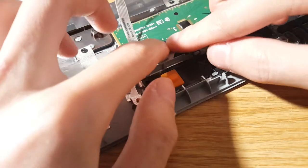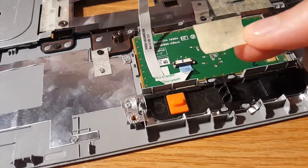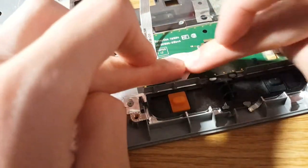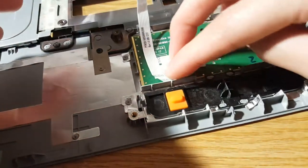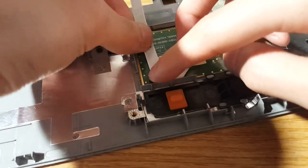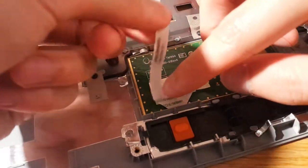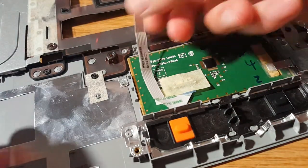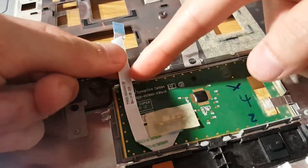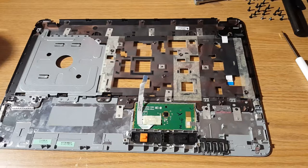You may or may not need this piece of tape — if it sticks, leave it; if it does not, you can just throw it away. Same thing with this piece right here. I don't know where the motherboard connector is on this palm rest so I'm just going to leave it the way it is. Go ahead and place this palm rest back on top of the laptop, line up the cable, and stick it back down where it should go.